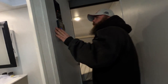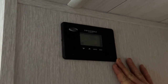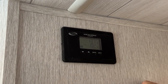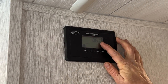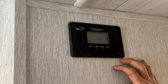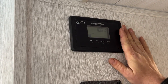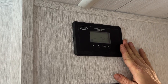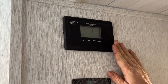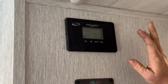Right here is where we start inside — up top is your solar controller panel. It monitors the battery and once the battery drops below a certain level, it allows current through to start charging. It's reading the battery at 13.7 volts; we're also plugged in. We're getting about 18.2 volts from our panels — that's actually pretty good. This is also a Bluetooth-style controller so you can download an app and sync to it, and there is an app for certain models as well.